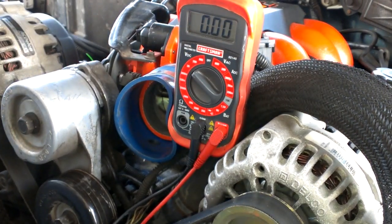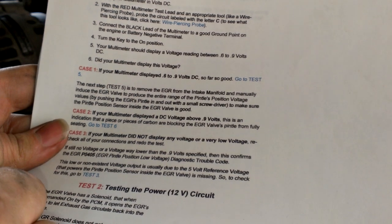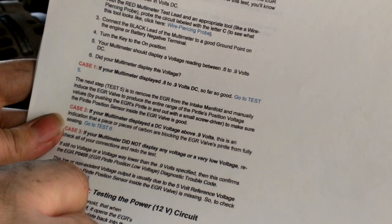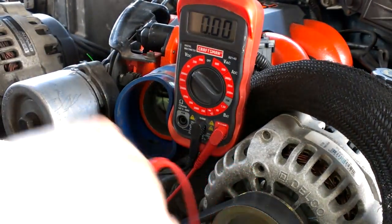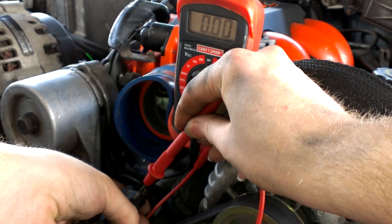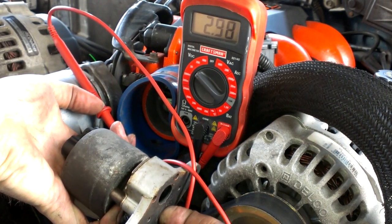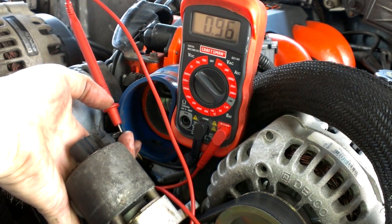So our next step is to remove the EGR valve from the intake manifold and manually induce the EGR valve to produce the entire range of the pintle's position voltage values. What you have to do now is take your multimeter — it's going to be kind of difficult to show you — put it in there, and then manually push the inside of the pintle. You've got to get a screwdriver and push it all the way down in there, but the maximum it's supposed to be is 4.5 volts.